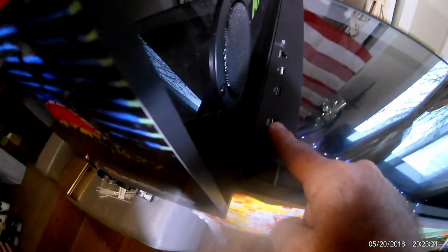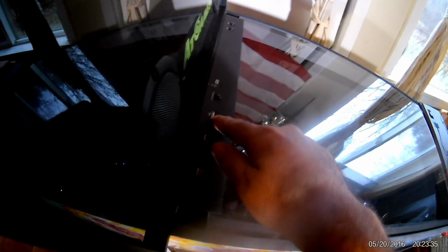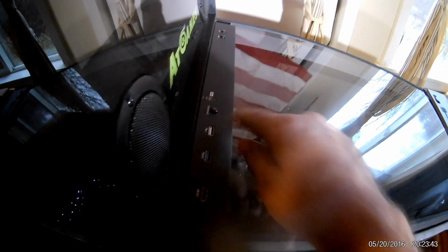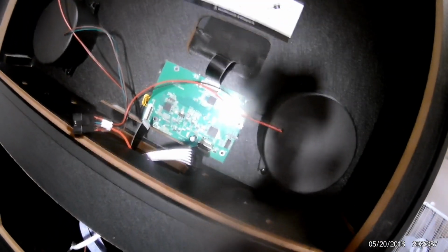Now, the important thing is to show you how to use this. We have an HDMI here that connects to your computer or your Steam Deck. Then this is the regular USB that connects maybe a coin-op. You can put a hard drive on here. And this is the OTG. The OTG is so that you can use your controller panel with your computer. There's a channel switcher, so you switch between the board that's on your computer and the one on your pinball. That's the board for the pinball, and that's the VIBS that I was telling you about.